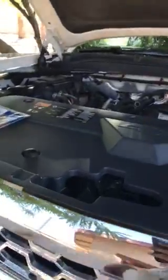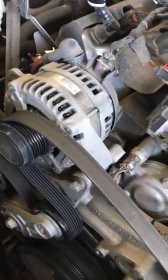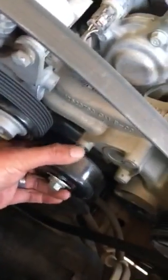This is only a $26 job if you do it yourself. I removed everything that goes from the air filter to the motor — the whole plastic casing. Once you remove that, you get some room to work. Then you need one of these tools — you put it on the tension pulley to remove the belt.